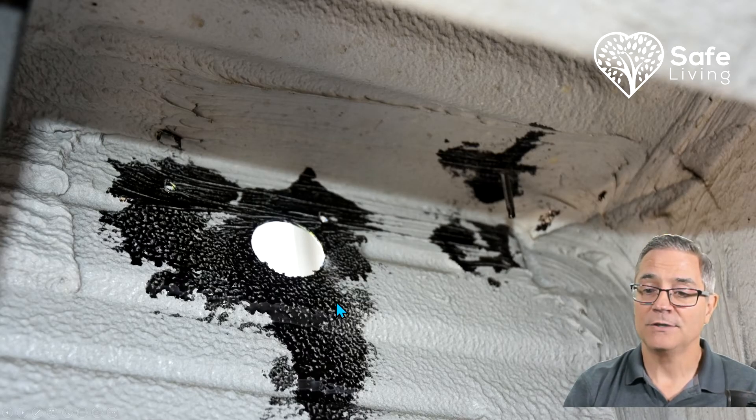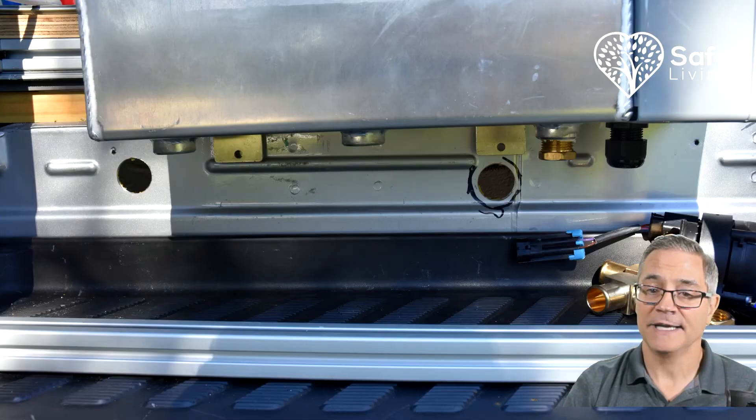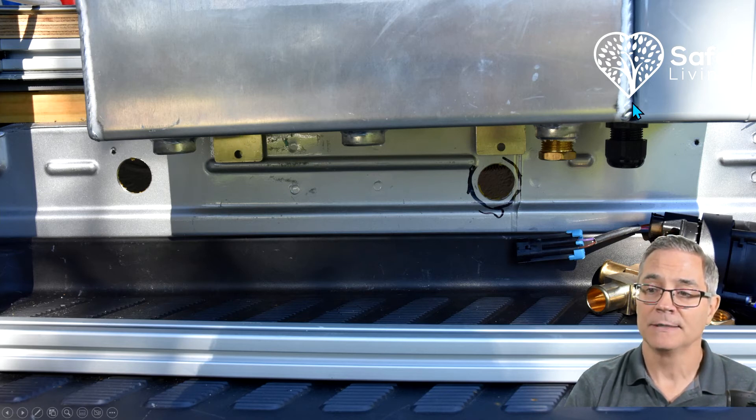The first thing we need to do is drill holes in the van. Anytime you drill a hole in the van, measure two, three, four times before you drill, because you can't fix it once it's done. When I drill holes, I always apply this POR-15 rust prohibitive material to prevent rust, especially since this is underneath the van. The glycol tank has three ports underneath and you're going to need two of them. The plug can be moved wherever you need it — I ended up moving mine down. You also have to worry about all the indentations in the metal to make sure your bulkhead fittings go through the van cleanly.